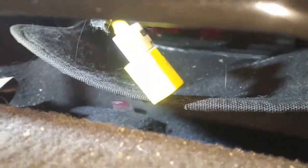Here we're down underneath the driver's seat, and lo and behold, there is an airbag connector that has somehow managed to disconnect itself. I'm going to turn the key off — I don't want to connect that with the key in the on position. It'd be best to disconnect the battery too, so I'm going to disconnect the battery, turn the key off, disconnect the battery, reconnect that, and then see what happens.